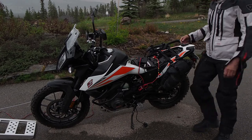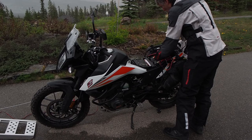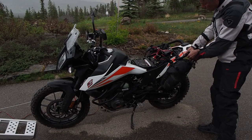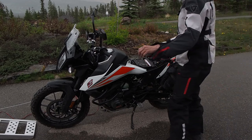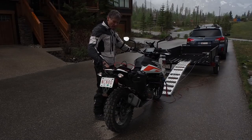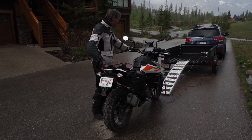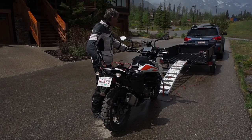In terms of body position, what I like to do is put the controller between my luggage straps so it doesn't fall. I wrap this under the hand strap and turn it so 'in' is at the top. I leave the bike in gear and flip up the kickstand. I've got the controller in my right hand while I'm hanging on to the grab rail. I leave the bike in first, pull in the clutch, and then start the winch. I use a stool alongside the trailer to reduce the amount of step, then push the controller to start the winch.